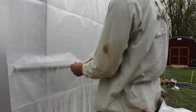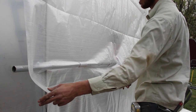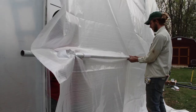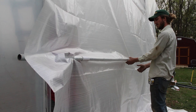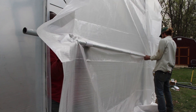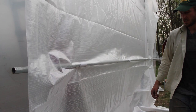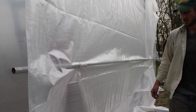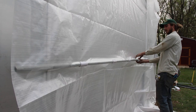I have two sets of lines and we're going to use the bottom line for securing the snap clamp. I'm holding the bar against the framing and putting the snap clamp on — the top of that snap clamp is lined up with the mark I made. I'm putting another one in the middle, using the bottom set of marks, then running to the far side and putting another snap clamp on. These are just to hold them in place. With only three snap clamps on and no pressure, the long roll bar is resting pretty evenly, so we're going to grab more snap clamps and fill in the spaces to provide more support.